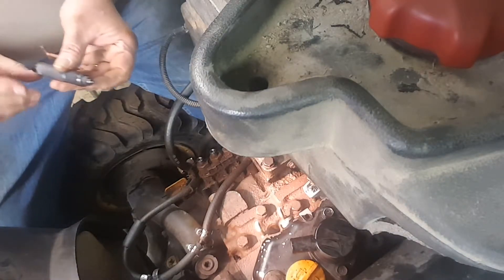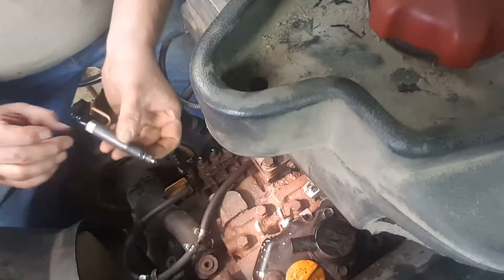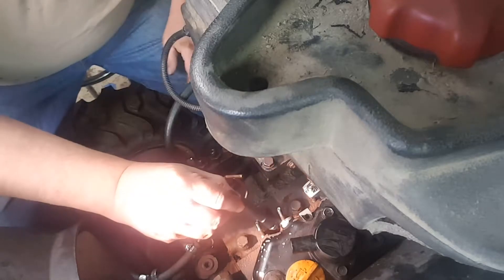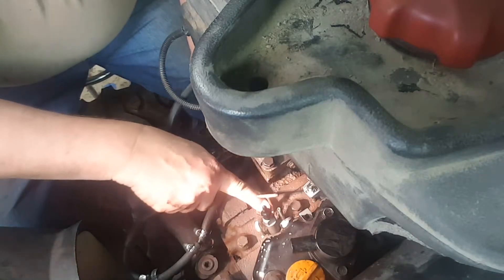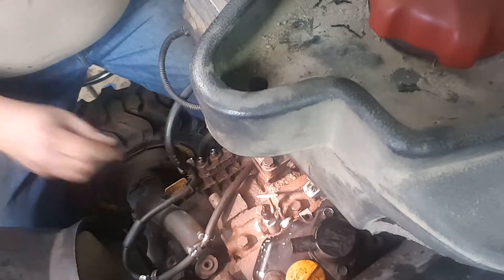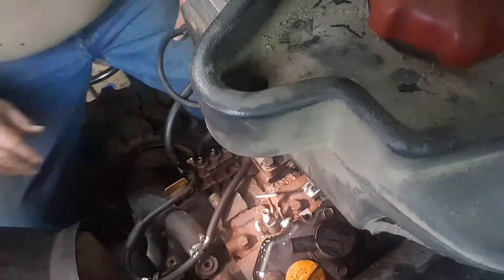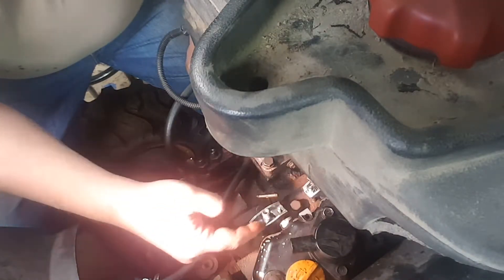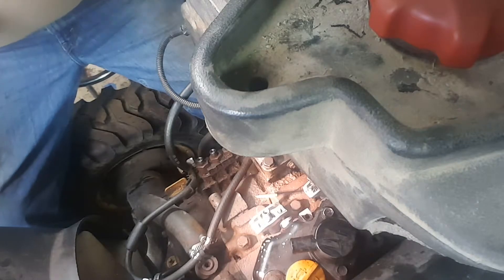It's too difficult to get that in there, and the trick is this cap has to line up right here on the injector. There are two flat spots that this goes down in and sets, and the return line has to go in between these two bolts. There's a knockout right here for this in the top of the head. So carefully set that down in there, make sure everything lines up — flat spots on the sides — then put your two new thrust nuts on.